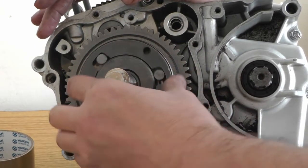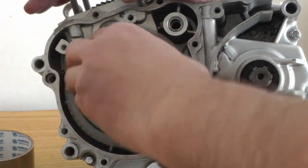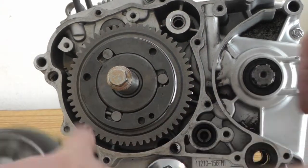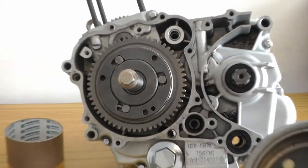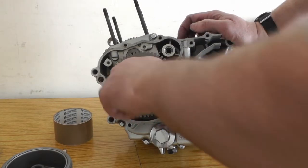So that's basically how they work. They're allowed to freely go one way, but when they go the other way, the bearings grip the inner wheel and turn the starter ring, turning the engine over. The only reason they aren't turning the engine over now is because it isn't joined via the Woodruff key. Once the Woodruff key is on there and it's bolted to the flywheel, it would turn the crankshaft.